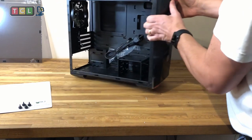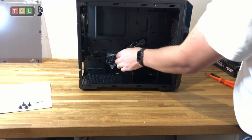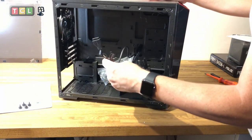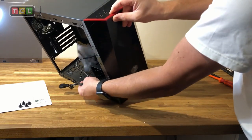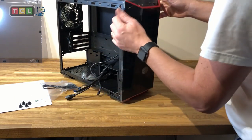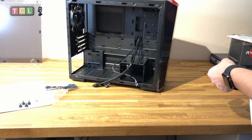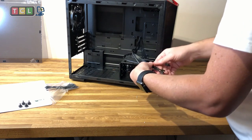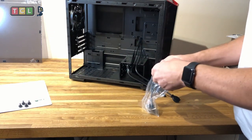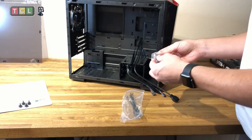Also in the case you have the other bits and pieces — remove the tie wraps, and in the middle of the case you can see the cables for the breakout that connects the top front connectors to the motherboard. The biggest connector is USB 3. On the top front outside you have USB, headphone, microphone, power switch, and reset switch. All of them will need to be connected once we get the motherboard in. Just familiarise yourself with the type of connector they are.